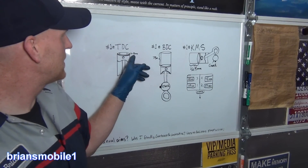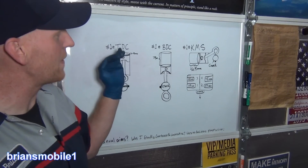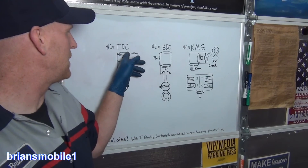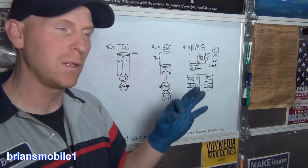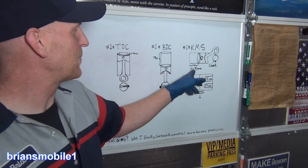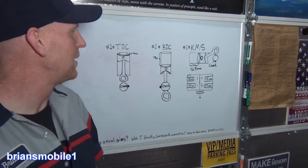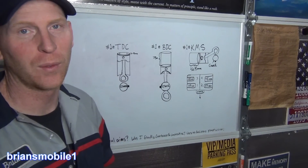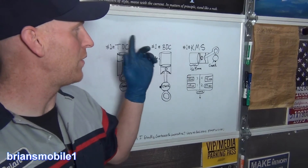The valves stick out about 3 to 4 millimeters depending on how much carbon is on them, and then there's the little indentation. The head gasket is actually one millimeter thick. But because you have 46.8 millimeters — I rounded to 47 — there's no way it's going to hit. So you don't have to worry about it. Do you rotate it clockwise or counterclockwise? It doesn't matter. You have all the room in the world. Nothing's linked up, and when the valves are opening and closing with this big amount of space, it's going to be fine.